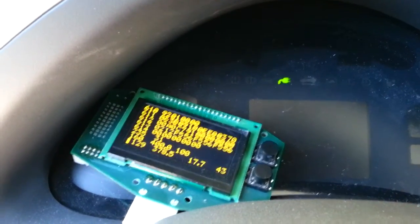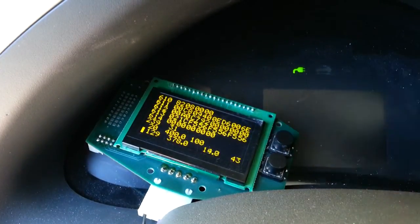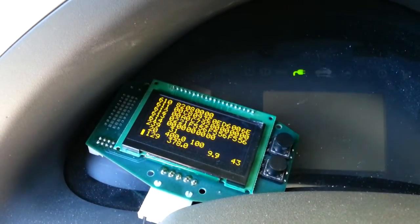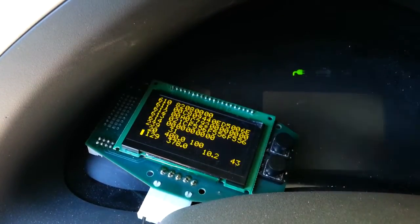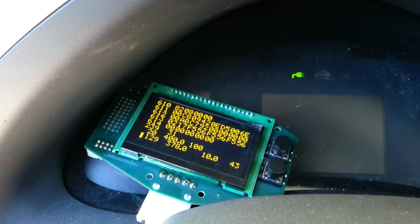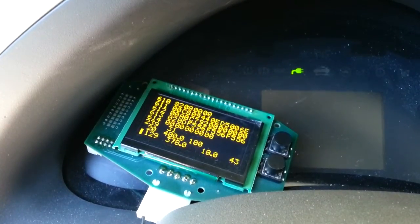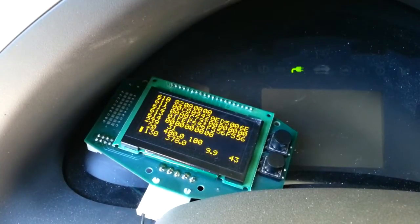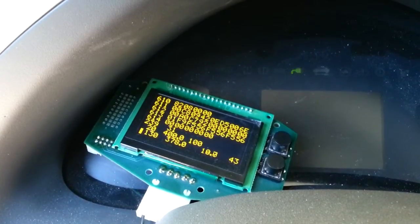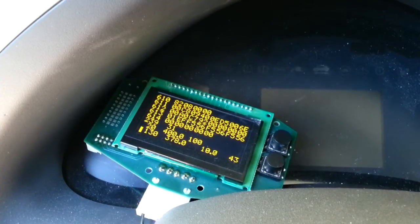If you want to cycle it over again, you just click it and it drops right back down to 2 amps, and you'll notice the amperage goes right back down. It's fully automatic — the Leaf is controlling everything. When the Leaf shuts off, the Brusa shuts off also; it tapers down, the Brusa goes down as well.